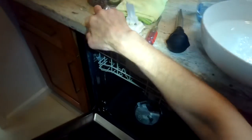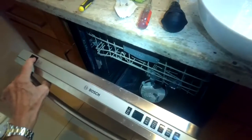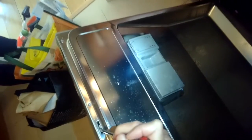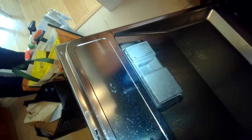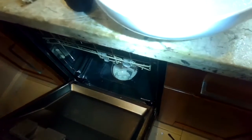I'll press these two buttons at the same time to start the drain cycle — you have to hold them for about three seconds. Then I can see what that impeller is doing. I noticed it would often hum, but if I gave it a little push with my screwdriver it would spin really well. Although it's rare on this machine, it just spun really well after I pushed it — I think the drain motor is actually worn out.